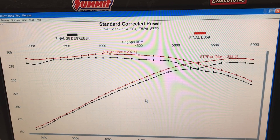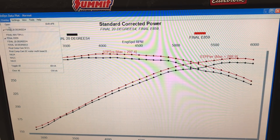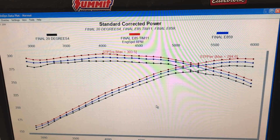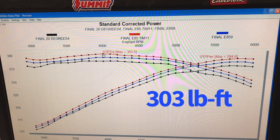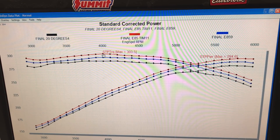The nice thing about E85 is why everybody runs it on a supercharged motor. I expected bigger gains just from replacing the 91 with E85, but here's what happened when we increased the timing. We added two degrees of timing everywhere through the entire curve and it picked up power everywhere. We went to a total of 22 degrees at the top, pushing peak power out to 295 horsepower while peak torque was up to 303.5 - you can round that up to 304 foot-pounds. A little more torque than power is normal for this type of motor with a mild camshaft and small cylinder heads - it's not going to make a lot of peak power but it has good average power production and a good torque curve.